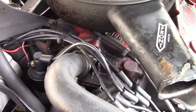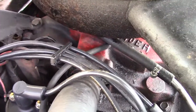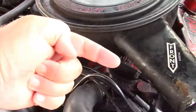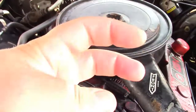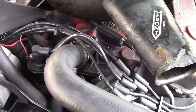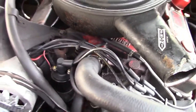As a last-ditch effort, we took the fuel line off - which you see there - and read about a trick where you blow compressed air into that line backwards toward the gas tank. You take the gas cap off and blow it out, because there's like a filter sock in the tank and that can be clogged up with stuff. So we blew compressed air through there. Obviously none of that made any difference.